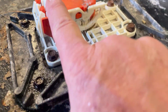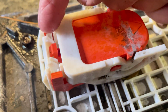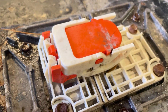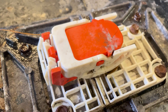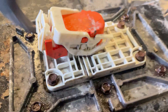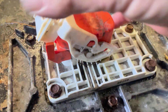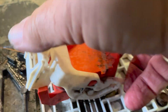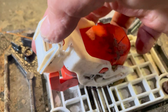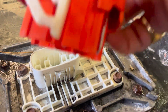The first part of the cutoff switch is just a lift, but it does have little plastic clips which can be a bit sticky when they get old. I'm going to use a little lever underneath the back of it just to get it going. Put a small pry bar underneath and it started coming up — it's still very stiff. When it gets to about this height, you need to release the second safety catch which is locking it down underneath. Press that one in and it goes all the way up to vertical, then it just draws off.